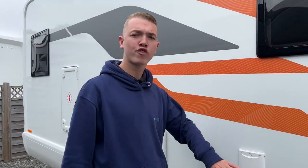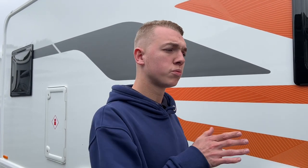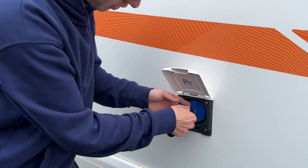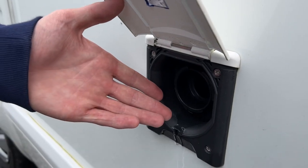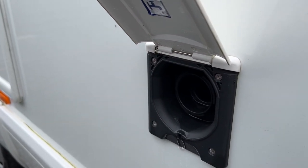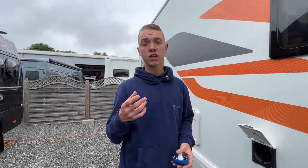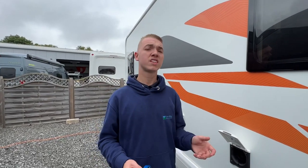The first point is your fresh water intake. This is where you'll require a hosepipe and some hosepipe fittings, as it's mainly just a brass tap on site. When you arrive, you'd normally drive in and fill your water up first before being allocated a pitch. The Swift key goes in here so you can unlock the lockable cap, remove the flat end of the hose into the vehicle, attach the other end to the tap, and start filling. You can check the control panel to see how full the fresh water tank is, or simply wait until it overflows — once it overflows, the tank is full.